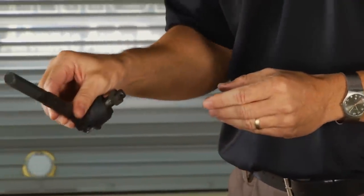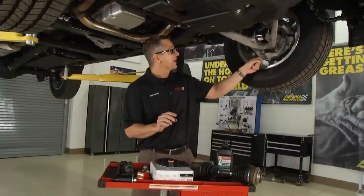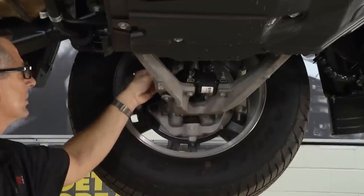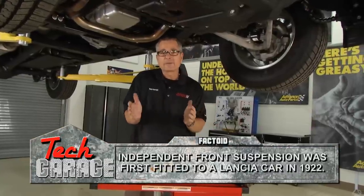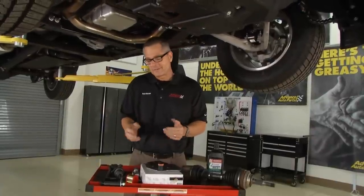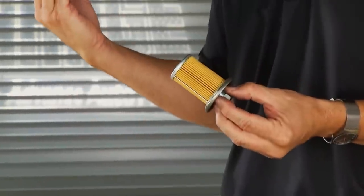There's a whole array of suspension components: you may have sway bar bushings, sway bar linkages, and tie rod ends. On this truck they're all located right here — we have the actual ball joint, tie rod ends, and bushings. A good thing you can do for suspension right in the driveway is just turn the car left or right and listen for any popping or perceivable movement. Those suspension components wear out and need to be replaced.